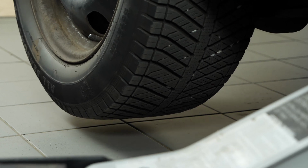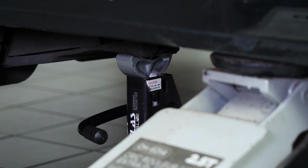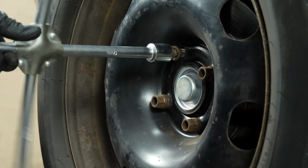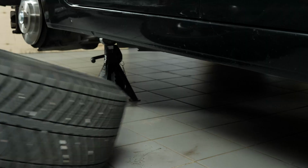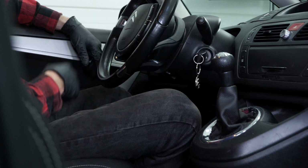Lift the rear of your vehicle. Place the vehicle on the axle stands. We strongly suggest watching the tutorial on raising your vehicle safely before carrying out this step. Don't forget to slide the wheels under the vehicle. Then release the handbrake or else you won't be able to proceed.